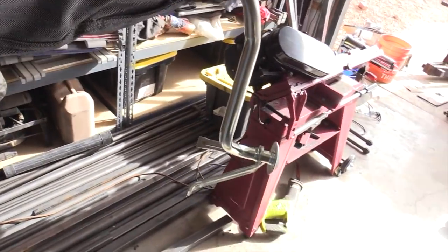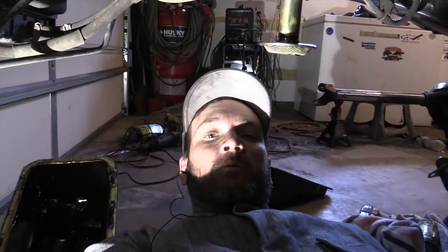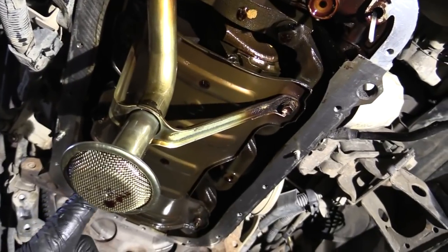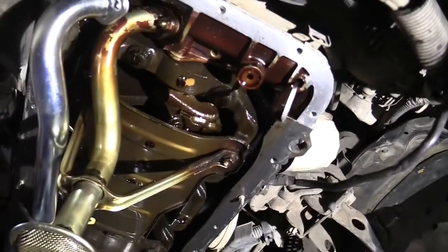I got the pickup tube to match the new oil pan. The oil pan and a bunch of other parts came from Trail Gear. Got all the oil drained, the gasket cleaned up, and everything looks pretty good under there. I've got a tube of RTV silicone left over from another project — should still be good. The pickup tube comes in from the front on the three-quarters, and it needs to hook up in the back, so the pickup tube changes to the back.